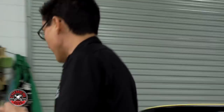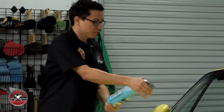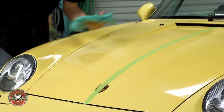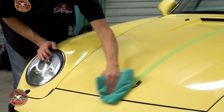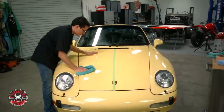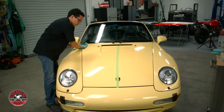I'm going to take some green painter's masking tape and tape this off. Then I'm going to take some detail spray to do the clay bar service. Now that I have the area clean and decontaminated, you can hear it feels very soft — there's no extra sound as I rub, it's very smooth. Nothing here but paintwork, so now it's ready to be polished.